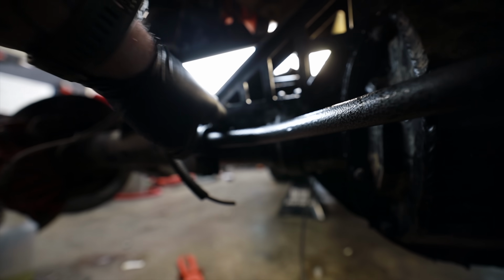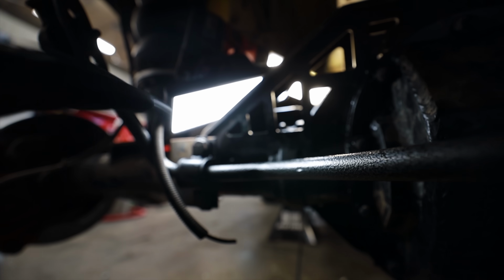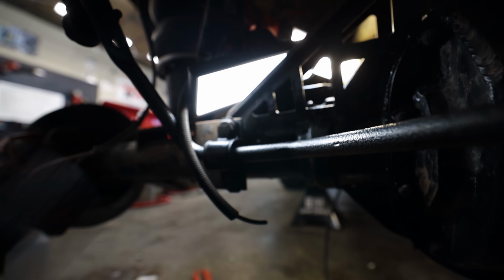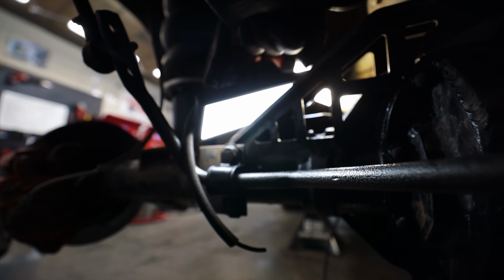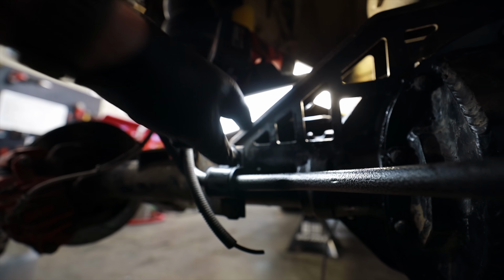And because it's in this rear corner, I bet that water and everything just goes right to the corner and gets right into our housing. Everything else passed. Everything that I used the soap and water on, zero bubbles out of it. So I think that everything else is sealing good, but clearly this big hole right here is a problem. And there's some mud and some different stuff in there from all the trips. So now I'm going to have to figure out a way to clean that out really well, and then try to maybe feed a welding rod in and fill that whole corner with weld, and then we can use this to test it again.